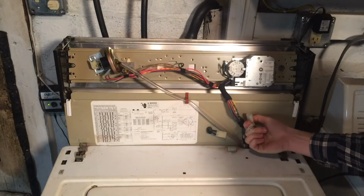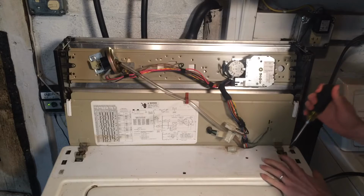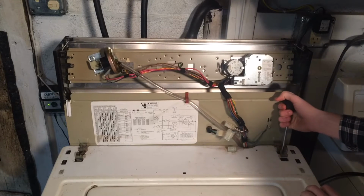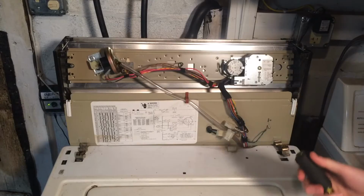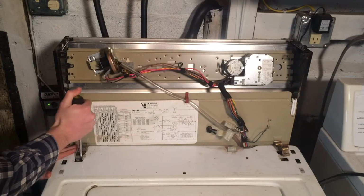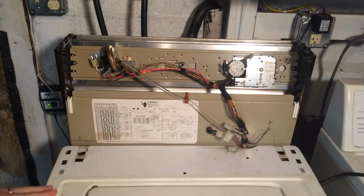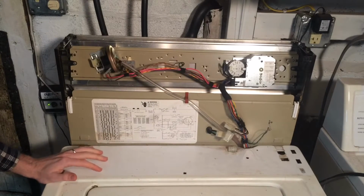They just snap together. Then take a flathead screwdriver and stick it in the very front of this metal spring here and push back on it, and the spring should come up, so it'll be loose like that. And do that on both sides. And that's going to release the back from the rest of the washing machine housing.